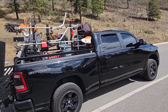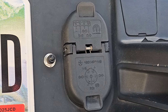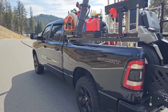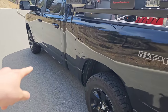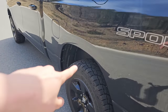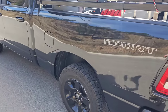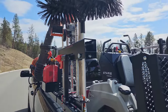It's the Airlift 5000, and I recommend it because if you don't install airbags, depending on your truck, you might be squatting a bit. To fill it there's a little nipple here — I have both lines connected to one. I usually keep it inflated to about 35 PSI. I measure from the road to the top of the wheel well on the front side and equal it out while loaded up. You can release pressure when not loaded, but I just keep it pumped up all the time.